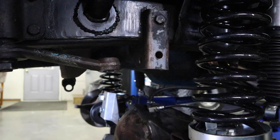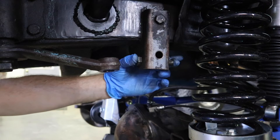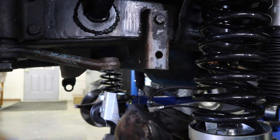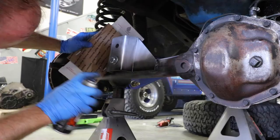We're about to finish up the install for the track bar riser bracket and still have to paint it. There's something I want you to be aware of that plays into body roll and bump steer and other weird driving conditions. Dry fit your bolt into your track bar bracket at the frame and give it a wiggle — see all that loose play? That loose play is going to transfer into the way it drives on the road. There is a fix: you can buy fancy weld washers and weld new 9/16ths washers on here, or you can drill it out to 5/8ths using a 5/8ths drill bit and upgrade it to a '76-'77 track bar bolt. You can get the track bar bushings and sleeves from James Duff.